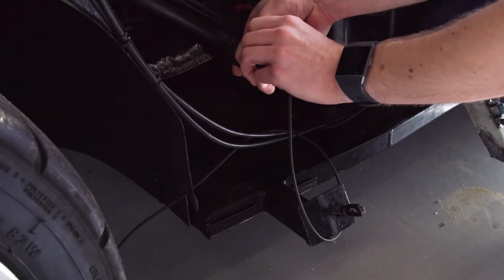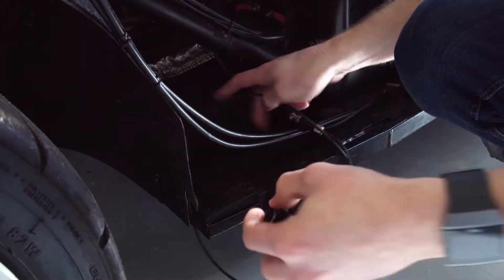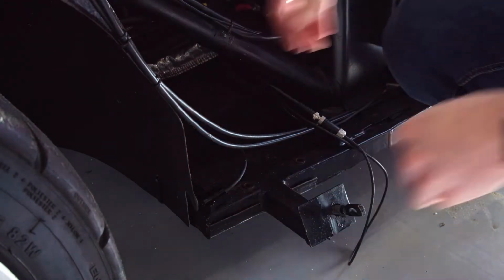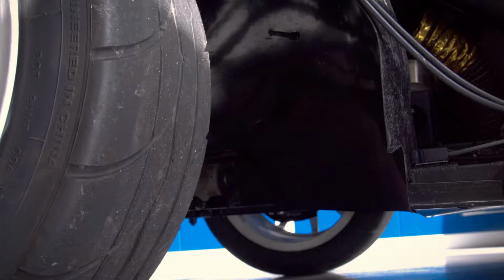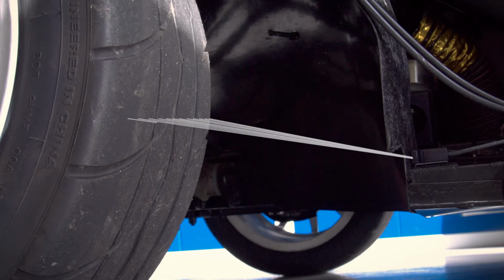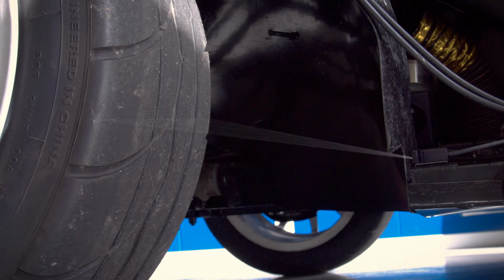The system is easy to set up, with 4 infrared sensors positioned directly opposite each tyre to ensure the full width of the rubber is monitored. Each sensor can measure up to 16 temperature surface points, ranging from -20 degrees Celsius to 300 degrees Celsius.